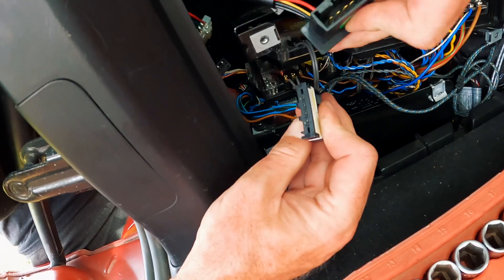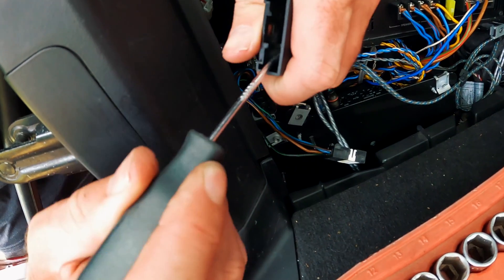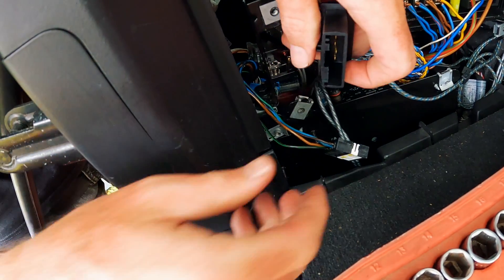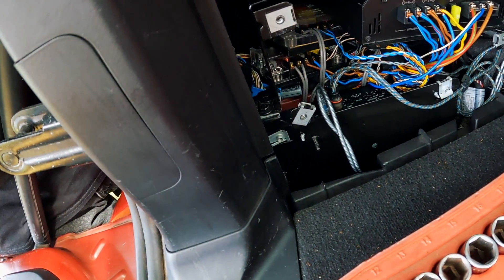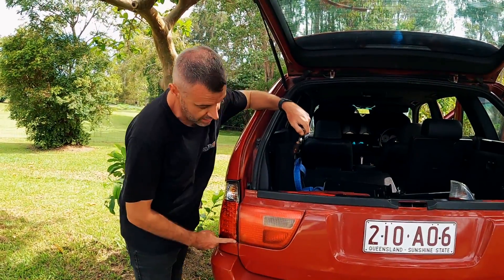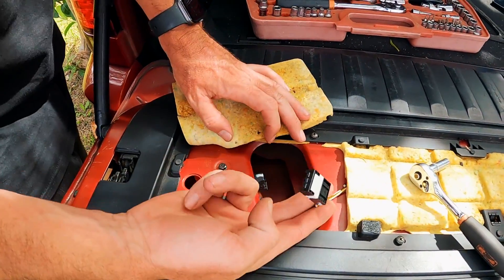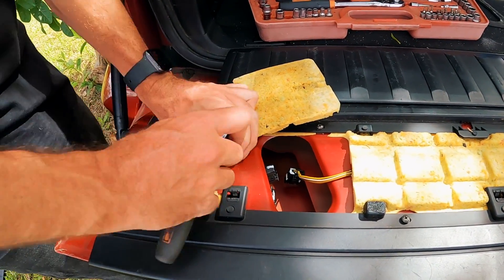The pins don't line up perfectly - this also happened on the other side. What I did was just bend them down a little bit and then you should be able to get them to clip in. Tail light is done. Now for the garnish - pretty easy to do. Pop that trim off and you get access to the three 8mm bolts. Unclip the harness before you go too far because it's a little bit difficult to get under it but super easy to get to while it's there.